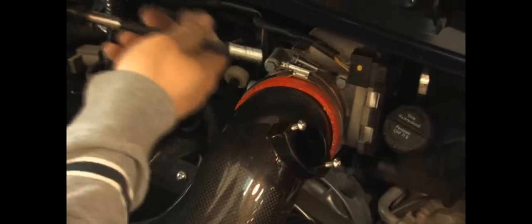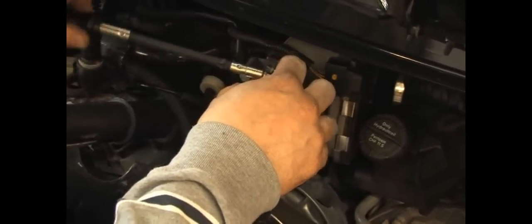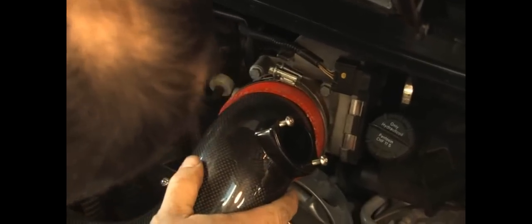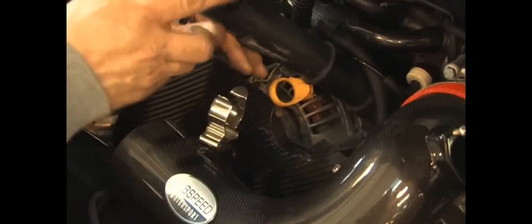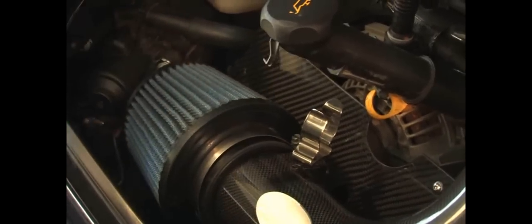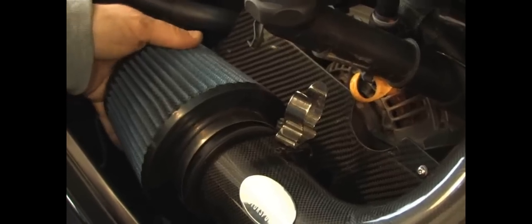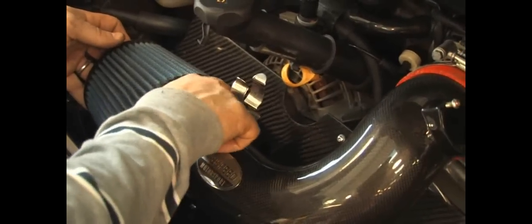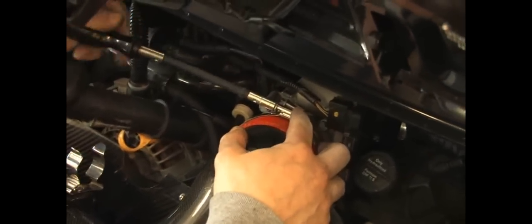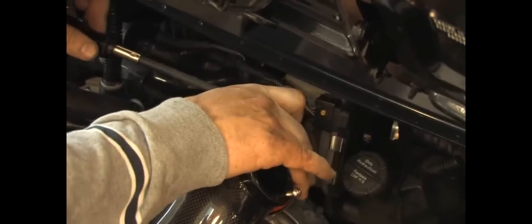Loosen that up a little — it doesn't need to be tight at all when we're starting. Just press it into position. This is our oil fill bracket; that can be left loose for right now. We're just making sure that our support tube is somewhat in the center. Everything is still loose. Now we can test fit our air filter — slide that on the hose until it comes up against a stop. That's where our air filter bottoms out, and that's perfect. Now we can start tightening things into position. First we'll start with our hose at the throttle body. Line up your hose clamp so it looks really nice and parallel.